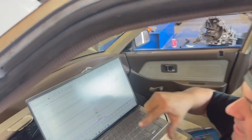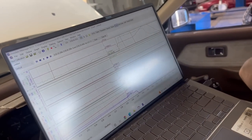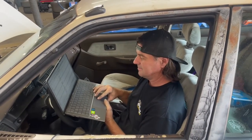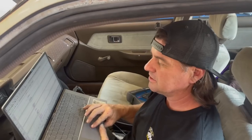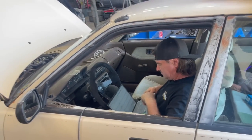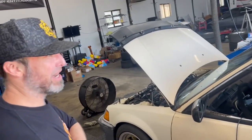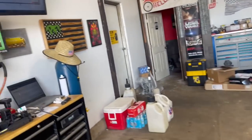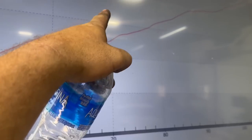And you were at zero, weren't you? 2.1 pounds, and yeah, I have the whole cam angle at zero. So you got no cam angle. Yeah, because that VTEC is going to come in pretty hard. I'm just going to tune him in each spot. Did it hit VTEC yet? Oh, yeah, it hit VTEC. He just has zero cam angle in it. I hadn't revved it up high enough to know if it was even hitting VTEC. So this drop right here is actually VTEC.